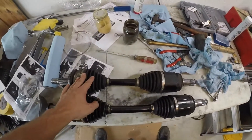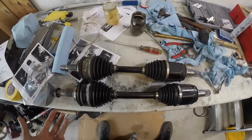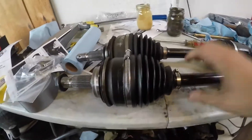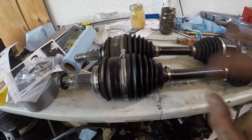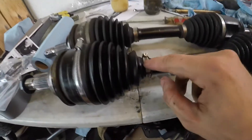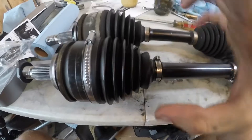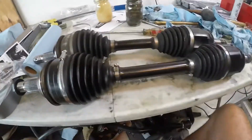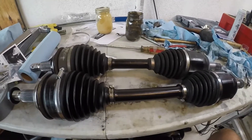All I have to do is rebuild this one and then that's really it for these rebuilds. A couple of cleanup items: if you're running extended axles, they talk about reusing these CV boots, but these will be at different angles now. Be careful with the clamps — you don't want them protruding into the plastic and cutting it during articulation. I moved them to the outside to make sure nothing is sticking inward, which helps prevent rips or tears.